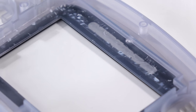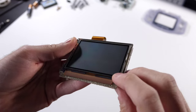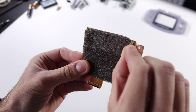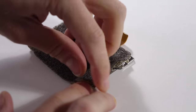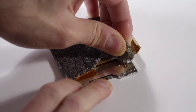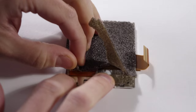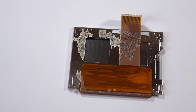Removing those guides bought us some breathing room for the front light, but we need just a bit more. So the next step is to peel off the foam layer from the back of the LCD itself. With some luck and patience, you might be able to remove it in one piece, but you do need to be careful not to damage the thin ribbon cable that runs up the back side of the panel. The foam peeled off in chunks for me, and it probably will for you too, but no big deal — just remove as much of it as you can.